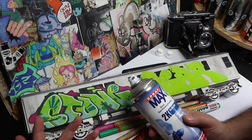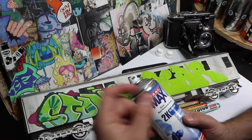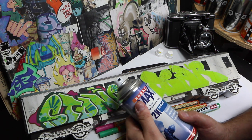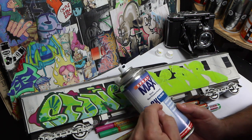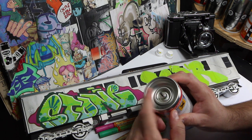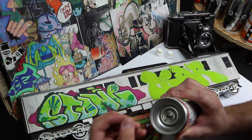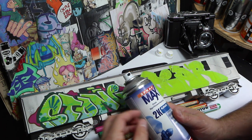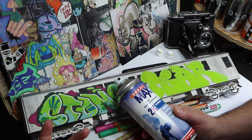And those of you who are familiar with these type of paints were probably wondering how they're able to do it in a can, because usually you have to mix them together in a container and then spray them out of a spray gun. Well, our lovely German engineers have come up with a new way to do this. Inside this can is another can. Can you believe that? Check this out. It's coming out the bottom like that. Now, you don't spray out of here. What this does is it creates an opening inside that mixes the two materials together to create the hardening product. So once it's activated, you have to use it right away. Well, within I think like 8 hours or so, or it starts to harden in the can.